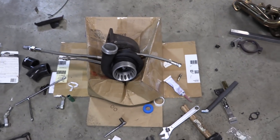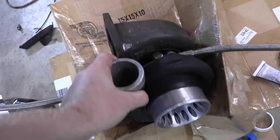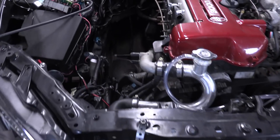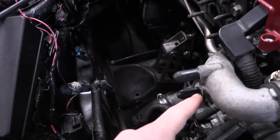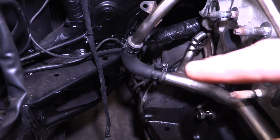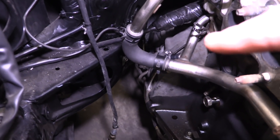Okay, we're getting close to bolting things up into the car. I got stuck a little bit last night so I had to stop. But we got the whole turbo assembled — water lines, oil drain line — and the oil feed line we'll throw in there last because it's on the car right now. We've permanently plugged off the rear water line — there's a hose clamp on there — it's really hard to see. That blocks off that water line.